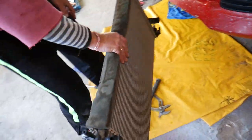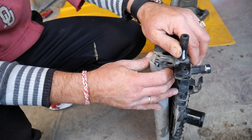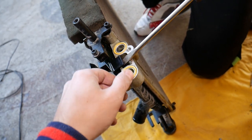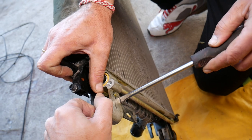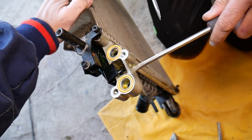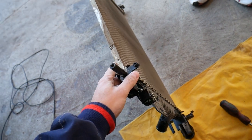To separate the AC condenser from the radiator: on top there is one clip — lift it up and pull the condenser out a little bit. On the other side there is a double clip, one on top and one on the bottom. Spread the top clip while holding it, then do the bottom one. Push the condenser out with the screwdriver if needed. Both sides came loose — lift the condenser out. Not too complicated once everything is out, but in the vehicle it could be much harder.